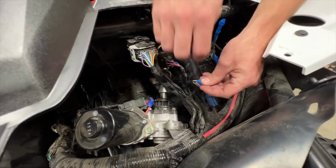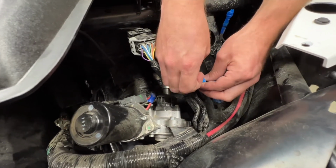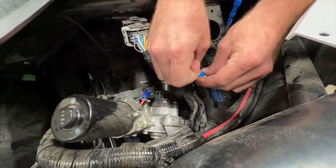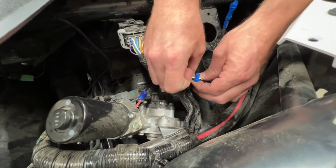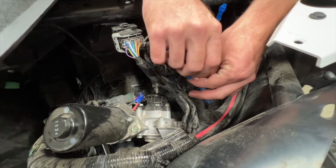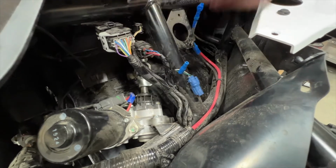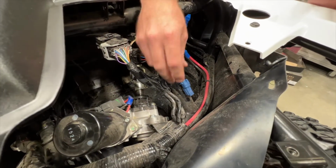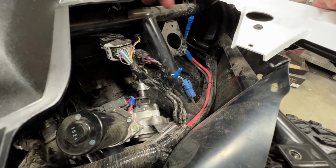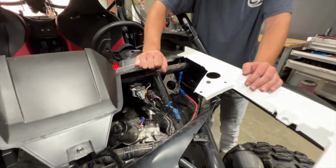So to install the posi tap, we're just going to put the bottom half of it around the wire here. We were doing some testing on this vehicle, so you might see that hole already in it. And then we're just going to thread this on from the top until it's bottomed out. Then this will be ready to run our accessory trigger wire back to our harness on our particle separator, and we'll get more into detail on that next.